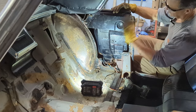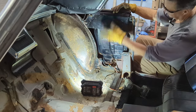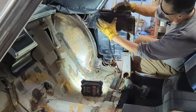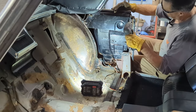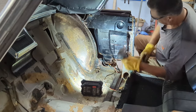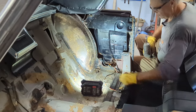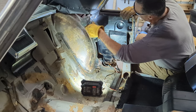All right, so here we are. I already have the trim removed for this car, all the interior parts like that. So we're down now to just the quarter window itself, and there's this plate that goes over it. It's a half-inch socket, so let's get that off and see what we have there. Save the bolts and stuff — you'll need them for the reassembly.